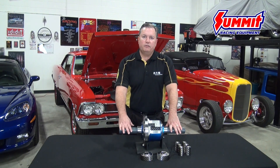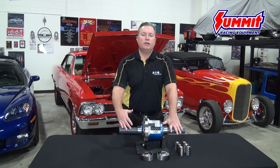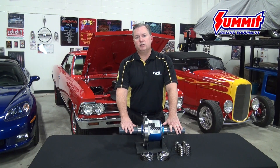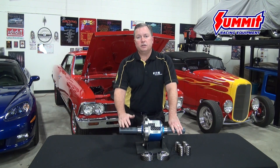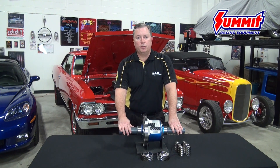Similarly, in an off-road environment, the TrueTrack responds to changes in traction via those gear separation forces, making sure that torque is being delivered to the combination of wheels that gives you the most mobility. All of this happens transparently to you as the driver, making it one of the most versatile products we have. It can be applied in the rear axle, front axle, or both, and in normal driving conditions it's an ordinary open differential, so you can use your vehicle as a daily driver and then take it to the drag strip or off-road on weekends.